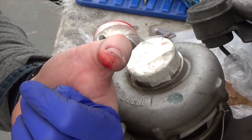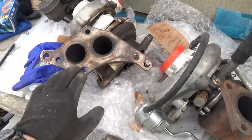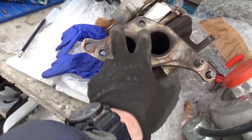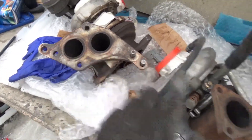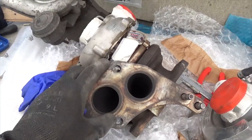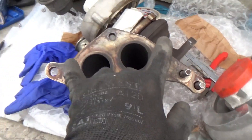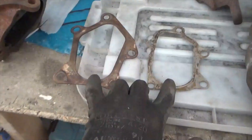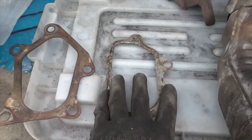This lock wire is quite sharp. As you can see the turbine housings are very different between the IHI and the turbo that came off the car. I have two ports that come from the headers on the one and one on the other. Using this turbo I'm going to get an equal length header that will fit this pattern. Where the downpipe bolts the turbine housing is slightly different as well — that's the twin scroll, that's the standard.